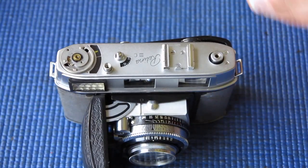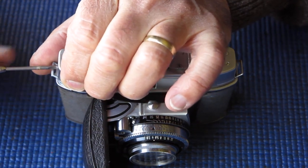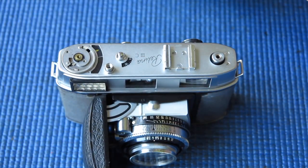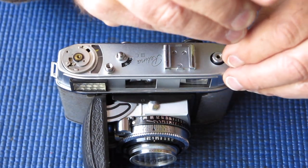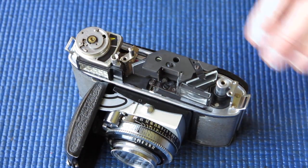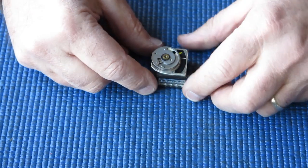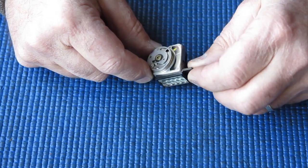Back into it to see what I can find out about this meter. I thought I was just 10 minutes away from finished — just goes to show how wrong you can be. Always hold your finger on the top of the meter before lifting the top cover off, otherwise it pulls off with it — sometimes that can break things. The needle's swinging, I can see the needle swinging, but it's not swinging back to the rest position. And I'm not seeing any response to light.